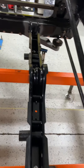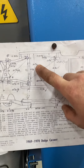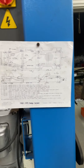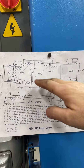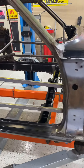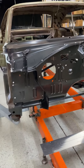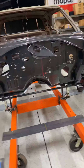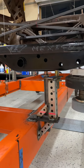I thought I would just share this for anybody thinking about making a frame jig. I certainly see the benefit in having one. When you've got a car in this condition — I have no rear frame rails to go off of whatsoever, they were completely gone, front frame rails completely gone, rockers completely gone — this drawing gives you dimensions for your rockers so you can verify your width. This car is 56 and 9/16", to the bottom of the rocker. Once I had those true to each other and the body square to the rockers, I knew I was good lengthwise. Everything's true and square within a sixteenth of an inch. The tolerance on this car is plus or minus an eighth, for a quarter inch total tolerance, and I've verified that in the measuring I've been doing as I go along.